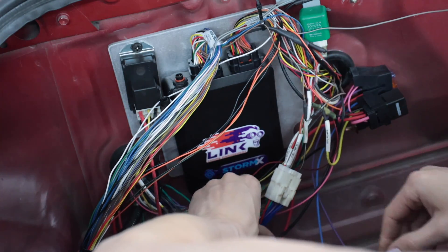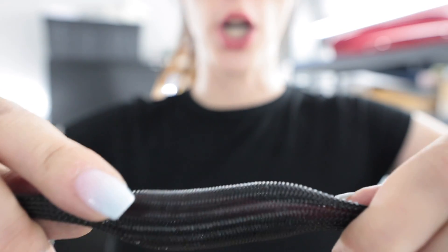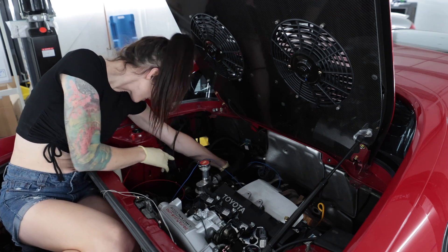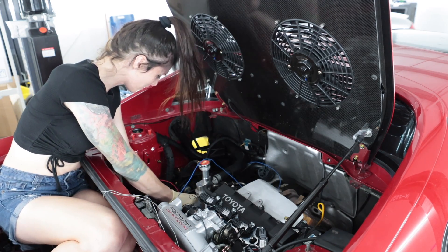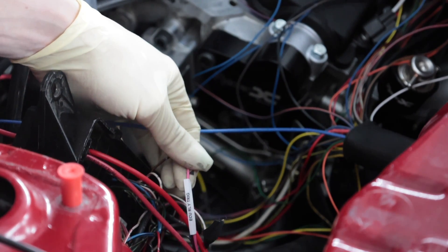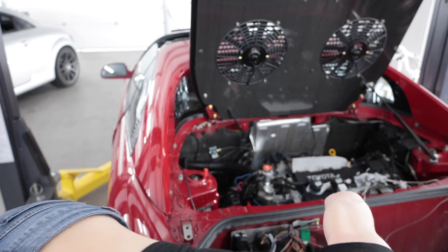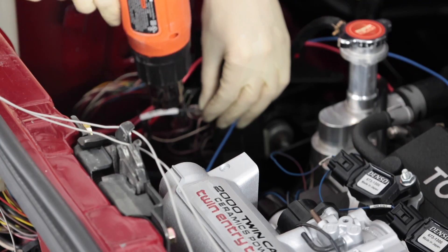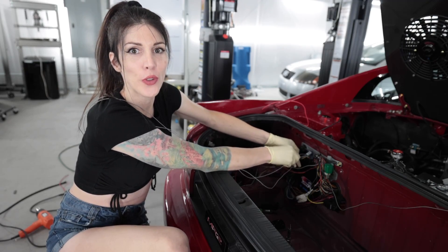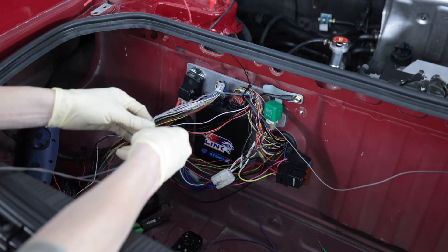Terminal two. Fuel pump relay — I got a heat shrink, but you get the point. This right here is the power wire and the ground wire for all the cooling fans back here in the engine bay. It looks like a snake eating a worm or something — Legends of the Hidden Wire. I route that down through here and then it's got to follow the ground wire. Last thing I got to do under this fuse box is connect this brown wire to this pink wire. This pink wire is the trigger for the relay that is powering the ECU. Never a good sign when I'm soldering and it smells like burnt hair. I have to braid some wires — making them pretty — because I got to do a twisted pair for the O2 sensor.